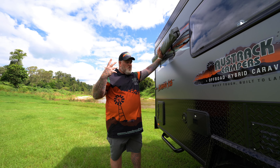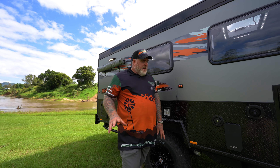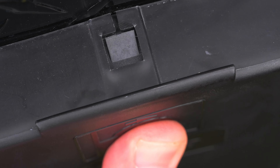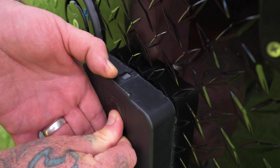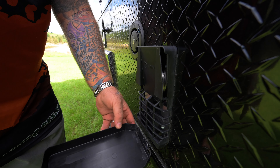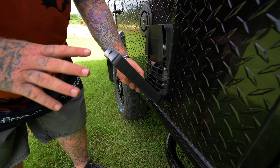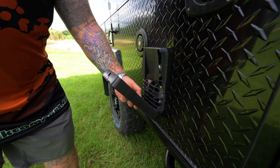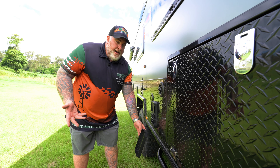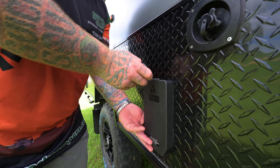When we're talking showers, you want to talk hot water. The van comes with a hot water system which runs off gas and electricity. When you're running it off gas, this vent cover on the outside has to come off. When you push here, the two little tabs at the top move — push in, pull back, and have it clear like that. It can't be sitting partially open because that will still not let it vent correctly and can throw an error code on your hot water system. Always have it completely clear. Tying it off so it hangs fairly loose is a good idea. To put it back, bottom first, lock it in — easy as that.